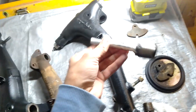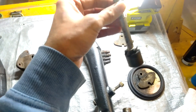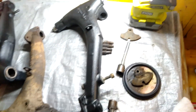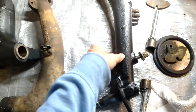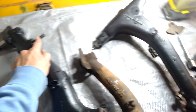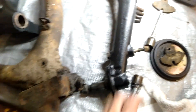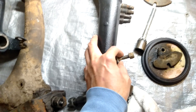The method I use to remove the old bearings: I just tack weld a bolt to the top of the old bearing, then put a socket over it with some washers as a spacer, put a bolt on, wind the bolt up, and it pulls the bearing out as you tighten it. You'll notice on this one it's been modified at some point — it's the left-hand side. The stud may have broken and they couldn't get a replacement, so they've drilled the whole thing through. Now it just has to be fitted with a bolt. I don't think that's going to be an issue — the brake plate fits on there so there should be enough clearance.